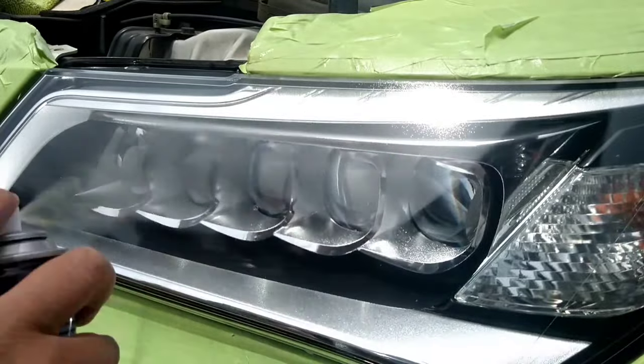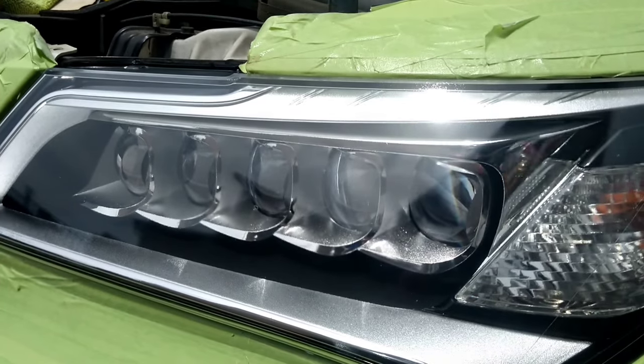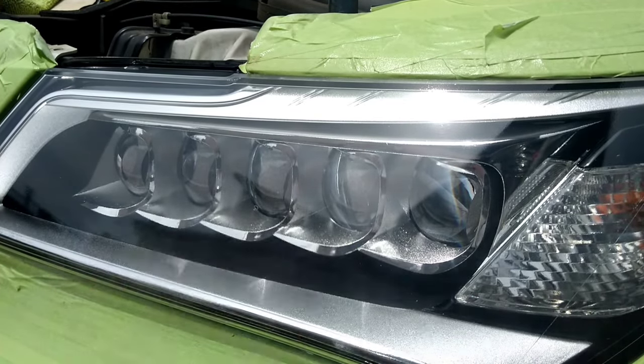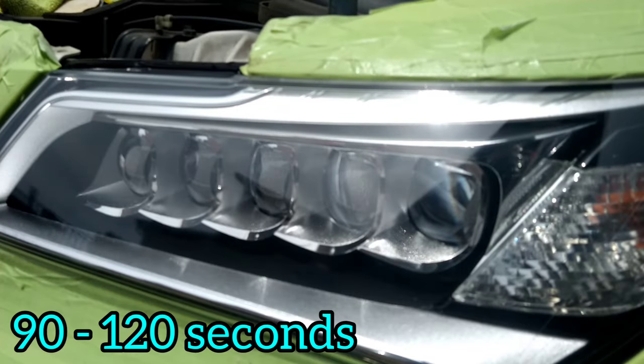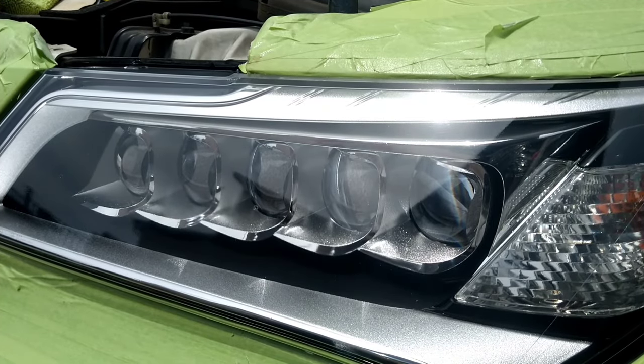Let's view that one more time. Using a heavy coat, but just one. This particular product dries in about 80-degree heat in about 120 seconds. If your coating takes longer, you should not be using it.